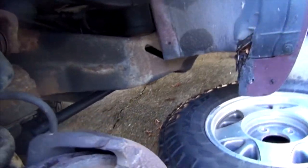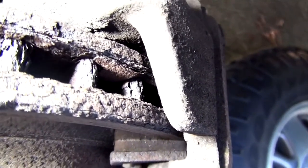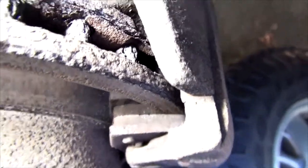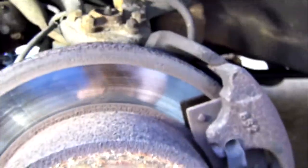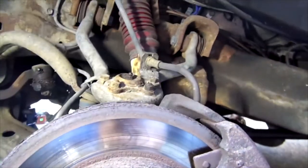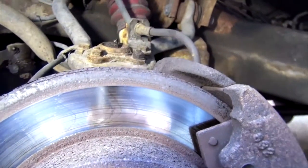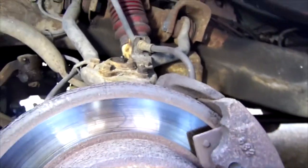Using the trouble light, you can see the pad looks like it's chewed up a little bit more on the top, closer to the caliper. The shiny bit you see on the top of the rotor is more rotor wear up there, and all that rust is supposed to be part of the rotor too. It looks like the brakes have been eating the top more. Let's check the other side and see if it's the same thing.